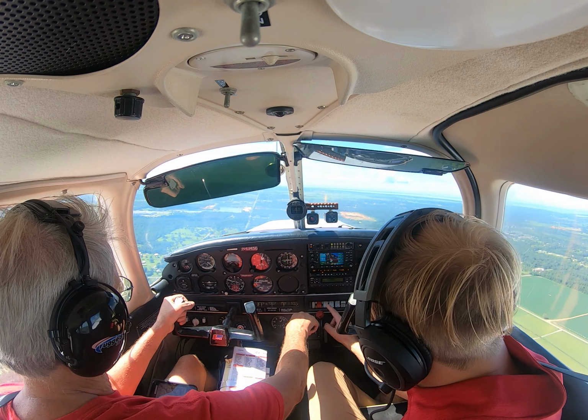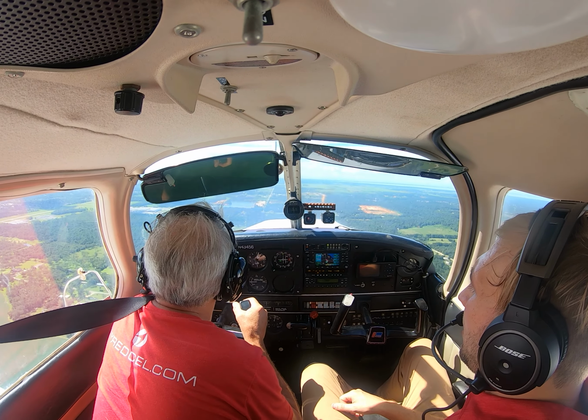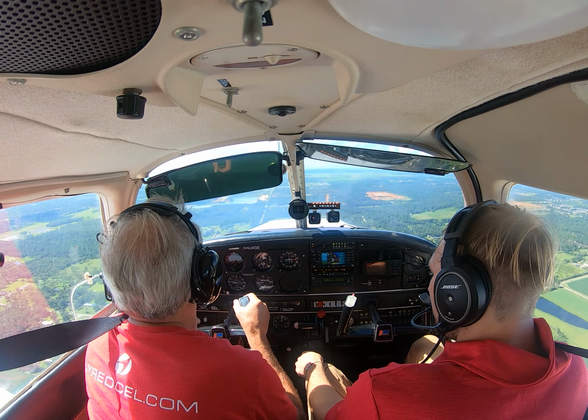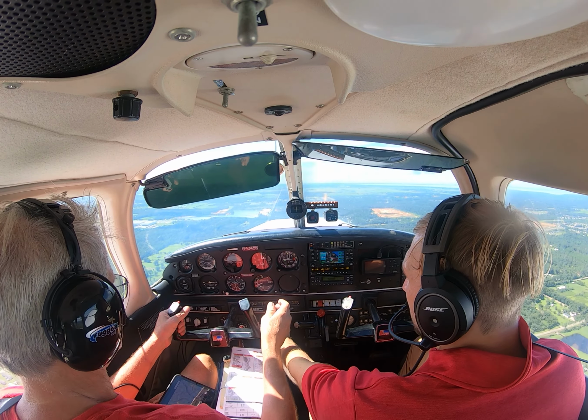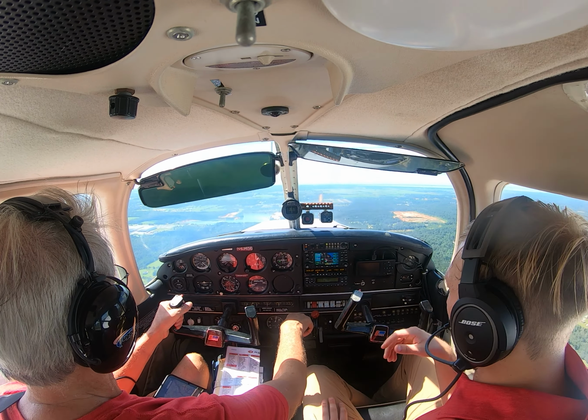All right. So, fuel pump's on, mixture's full rich. You can switch that tank over. Immediately, we go right over to our fuel pressure. We still got fuel pressure. Uh-huh. And normally, if we were in flight, we would turn it off, but we're in the pattern, so we'll leave it on.